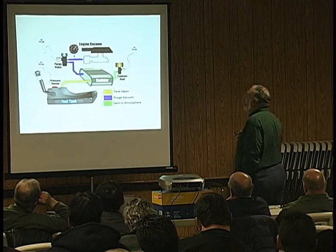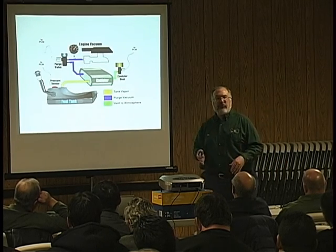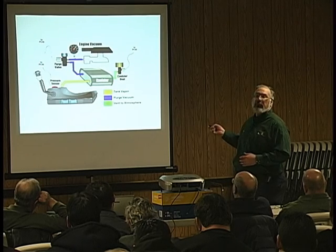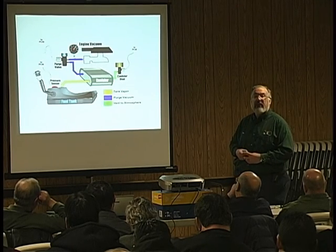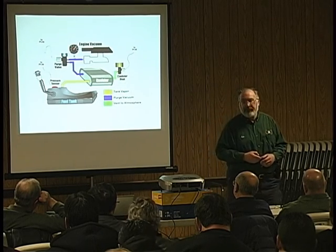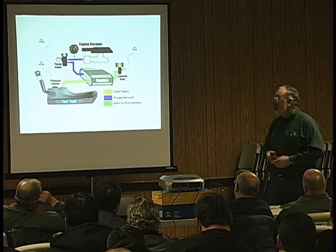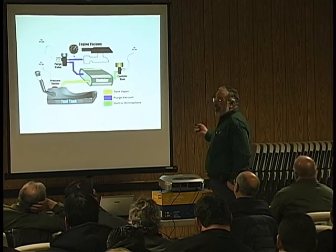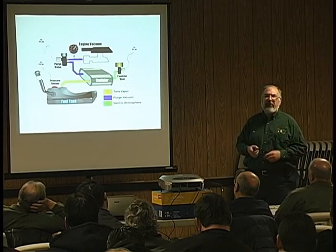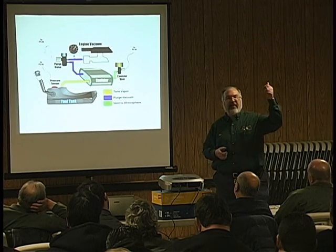What I do is I take the canister vent solenoid, and I take a power source. First I make sure that we do have power going to it. We should have power as long as we have key on or the engine's running, because the only thing the PCM does is ground it. Once I check that we have 12 volts, I unplug it, take a battery pack, and put power and a ground on it to make sure I hear the thing go clunk.